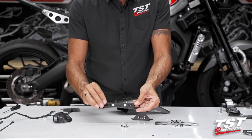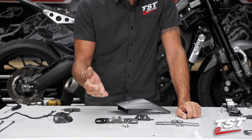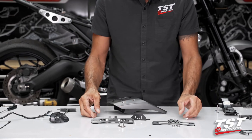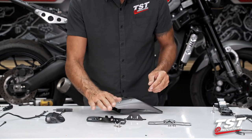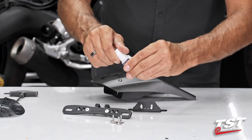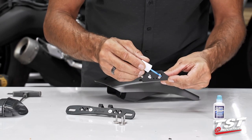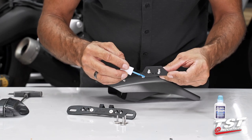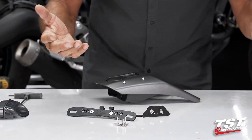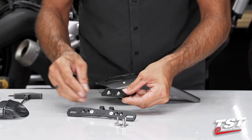Now obviously this doesn't arrive to you in this form — we do have an appendix chunk at the end of this video showing you the procedure for building this configuration out of the parts that come in the assembly. Since these are vastly the same with a couple of different nuances, I'm just going to put one on here. I do prefer our billet aluminum CNC machined setup, so I'm going to work with that. This is a medium-strength thread-locking compound. I'm going to get some of this stuff on the threads and these connections — this ensures that as you ride down the road tomorrow and in several years, these parts stay put and don't vibrate off.